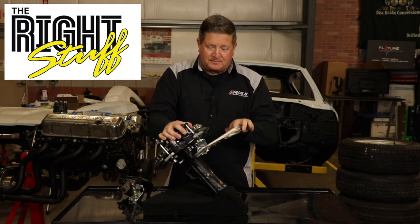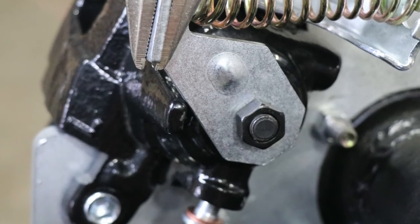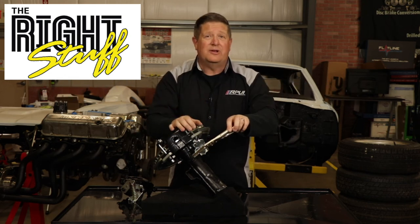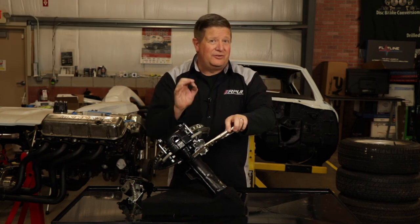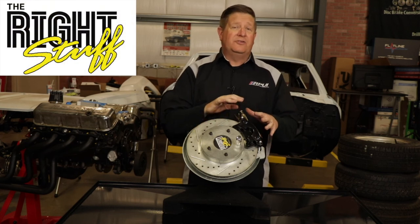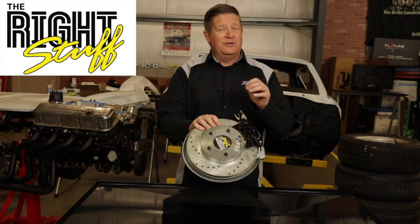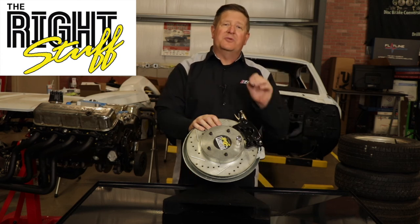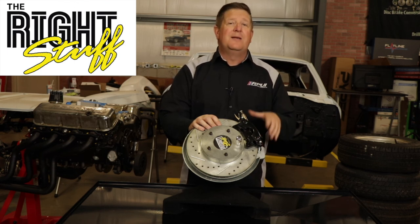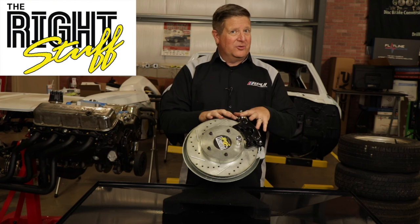Keep doing this — snapping it — a couple of times. What you're going to find is the gap between the arm and the stop is going to get smaller and smaller. Continue until the gap is roughly an eighth of an inch minimum, quarter of an inch maximum. It won't go further than an eighth of an inch because it has an internal limiter that won't allow you to adjust it too tight. To get the emergency brake piston and arm properly adjusted on this new assembly it took about 10 to 15 snaps on the emergency brake arm with the vice grip attached. This setup is critical not only for how the emergency brake performs but also how your brakes feel. Make sure the gap is the same side to side on your vehicle at the rear, so the pistons are adjusted properly on both sides — it ultimately adjusts that inboard brake pad.